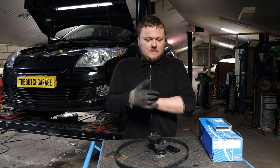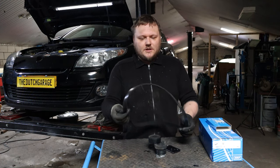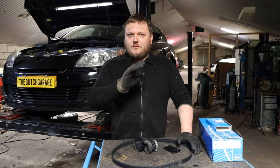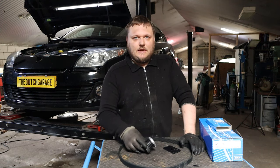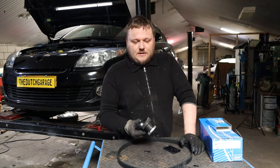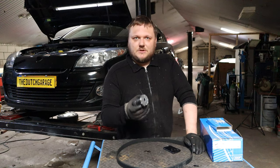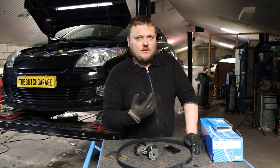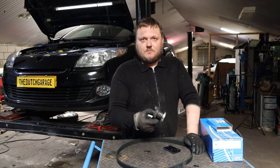So there you have it — how to change a multi belt from a Renault Megane. Of course these engines are in a lot of other cars. Just take it from me: don't do it from the top. Just remove the wheel and the inner liner — you will definitely have a much better time removing or replacing this. It is of course up to you if you want to do only the belt or do both. I most of the time do both. This tensioner isn't that bad, but like I mentioned before, this spring was definitely a lot softer than the new one. Because the chances are if you put on just a new belt, it is still squealing — or maybe within a short amount of time it starts to squeal, because the tensioner is more bad than you thought.